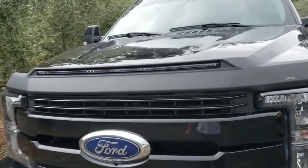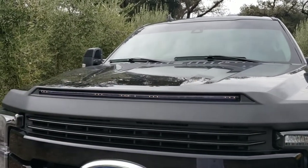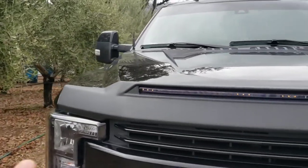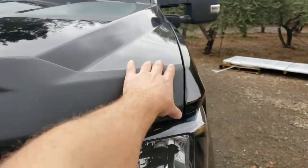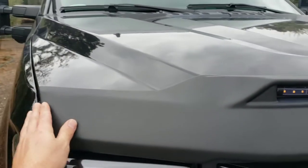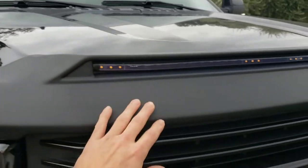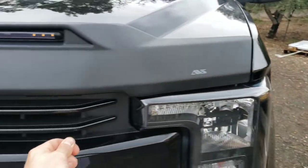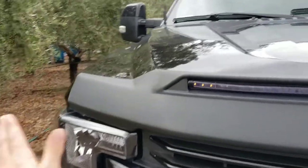What you do to put this guy on is there's some 3M tape along the whole bottom side and the whole top side. So you just clean your hood really good, wipe it down with the alcohol pads that they provide. Clean all the front side of the bumper really good, all the way up and around. Then you just peel off little pieces — there are portions on either side — you peel about 2 inches off, as shown in the instructions. Press the front, center it, press the sides, and slowly peel that tape out from up top all the way around, then press it all in.